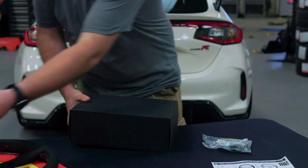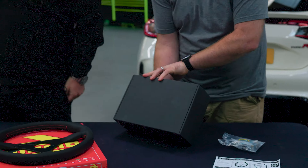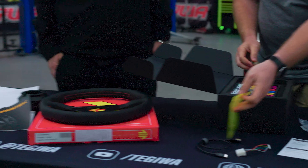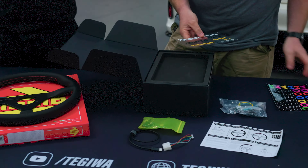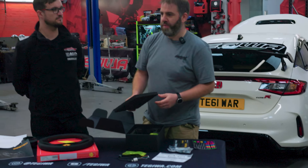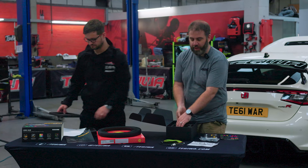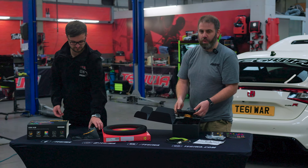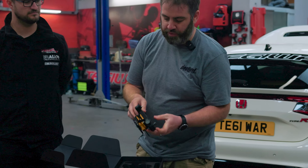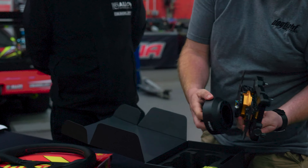So this one is the OEM hub — this works with road cars. There's also a CAN hub version, so if you've got an older car or race car, the CAN hub is what you want because that'll talk to your aftermarket ECU. The good thing about these is: going back to 90s cars like the DC2 or DC5, there wasn't really anything on the wheel except the horn. Nowadays everything's on a CAN network, so everything talks to everything else and if you take away one component you can cause all sorts of trouble. So it's really nice to have this — it's a go-between between the wheel and the hub.